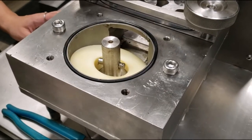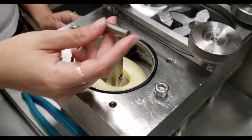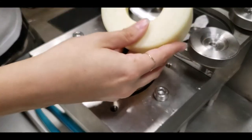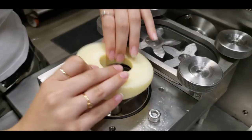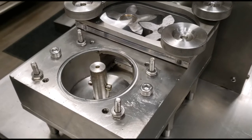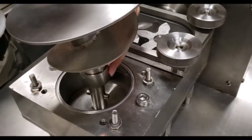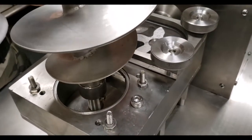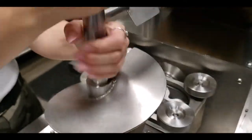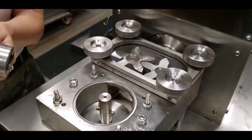After removing the hopper, you need to remove the inner piece first by starting with removing the pin. Over here in this section, you need a little bit more patience to remove this item. After the hopper is removed, when you are inserting the screw of the hopper, align it with that pin there when putting it on. Then you lock it. By locking it and trying to pull it up, it won't come out — that's how you know the screw is locked in and how you remove it.